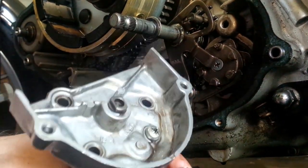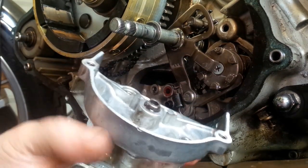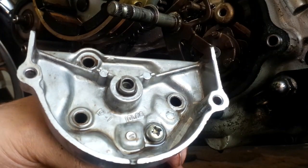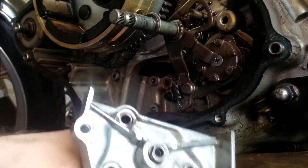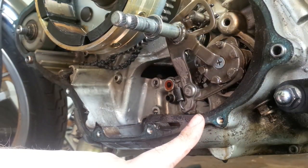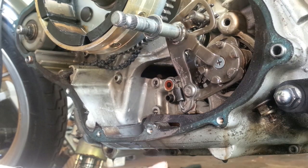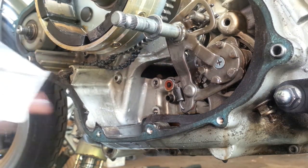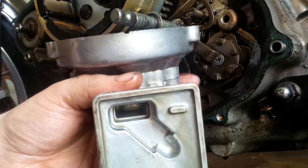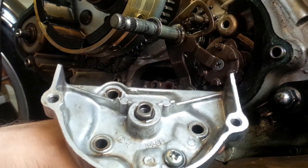That would be it. This is what I usually recommend if you find things in the oil when you change it — like silicon gasket bits that might have torn off because a previous owner applied too much silicon. Some people think the thicker they go the better it will seal, which is nonsense. If you find things like that, it is worth checking out, because you definitely don't want this pickup to clog up. If it's clogged, nothing will be lubricated and you're going to wear your engine out rather quickly.